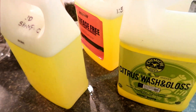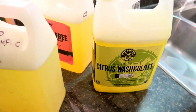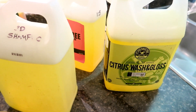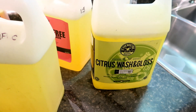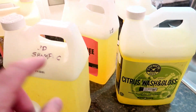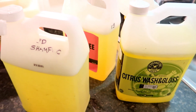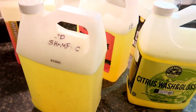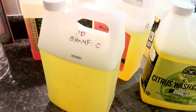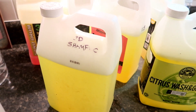I do the same thing with all the rest of my chemicals. My glass cleaner is diluted 1 to 10 — I use that mark in the bottom of the gallon jug and pre-dilute my glass cleaner in gallon jugs like this so it's ready to go. Super Clean — I do the same thing. With Super Clean, I'll take a 32-ounce bottle, fill it full of Super Clean undiluted, and then pour that into the gallon jug and fill the rest with water. That puts you at one to four. I like to mix it one to four because I use it on tires, rims, grungy areas, engine compartments, and door jambs.